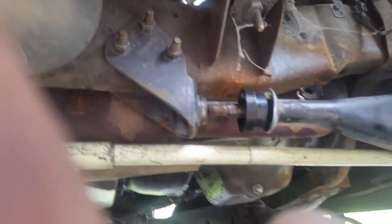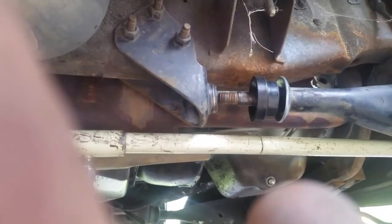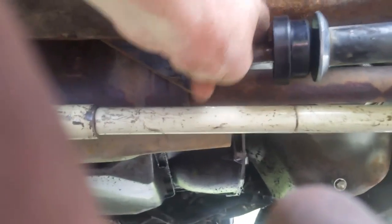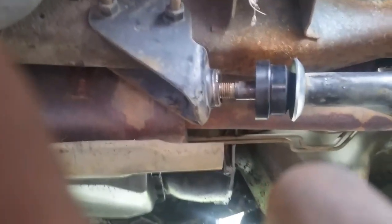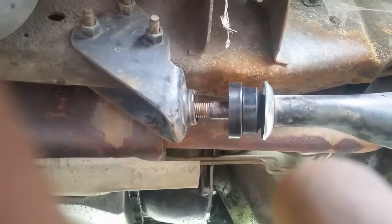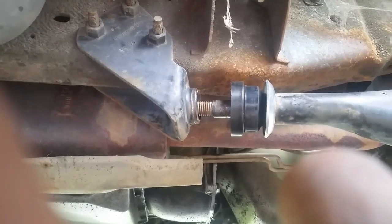I was able to sneak the bushing in. I've let off it a little bit, but I did have more gap there — I let off it because I was a little scared. I'm going to let off this now. I don't have the little jack pushing it over. Looks like it's going to line up with the hole — if it doesn't I can take a bar and pry it over. You can see it's going back in. There it goes, it's back in. Now I just need to push it back into position, get the other bushings and the nut on there. There's my solution. The other side I'm just going to unbolt, take the bracket down and do it normally. Thanks for watching.